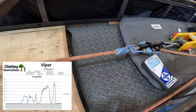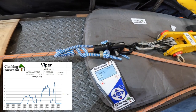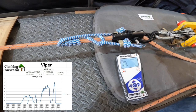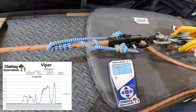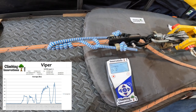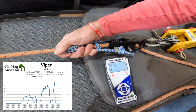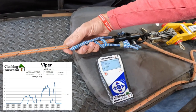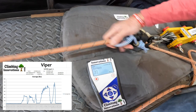Now we're going to bring it up to about 500 pounds and see if I can release it. There's about 500 — 492, now 525. Notice it kind of sets into it and actually starts to slip — it went up to 600 pounds and I can still release it. It's a little grabby but I can still release that at 600 pounds. Bringing it back up — there again it's 600 pounds — and releasing the hitch.